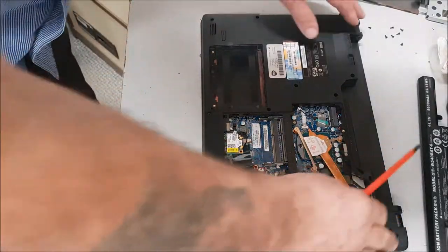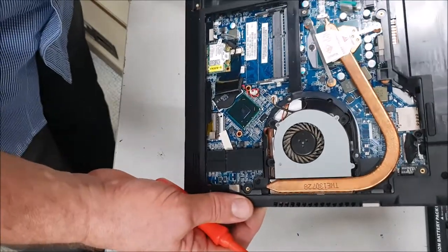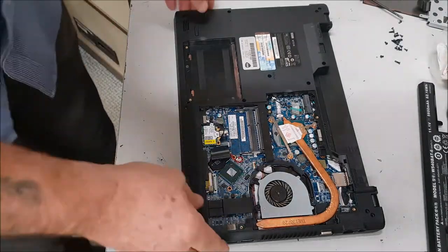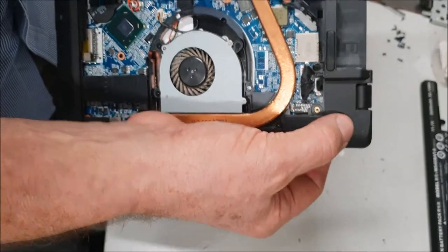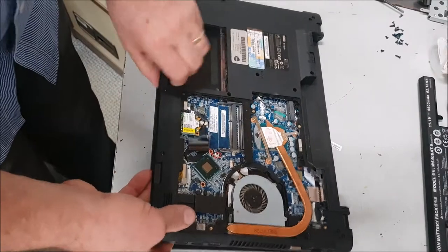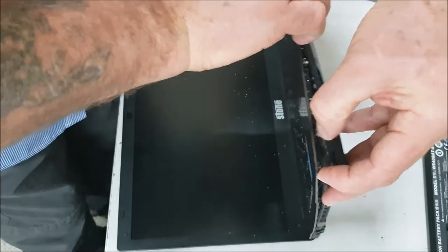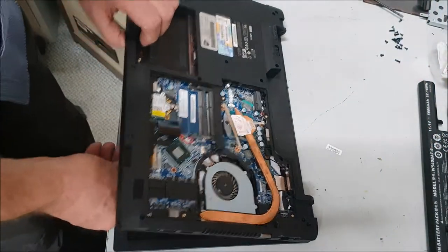What I'll do now is take all the screws off — you don't want to see me doing that — and I'll show you how to get to the keyboard. Back in a sec. Okay, all the screws out the base; there are two extra long ones just there each side, supporting the hinge I believe. Then just lift it up on edge.